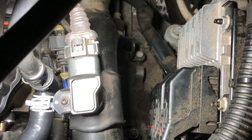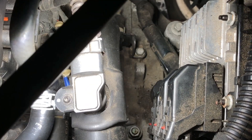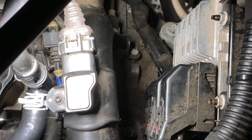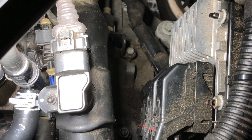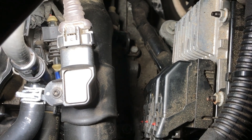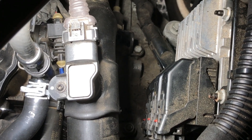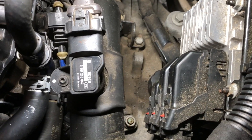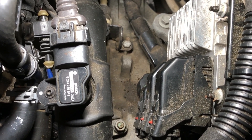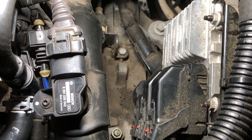That's how you properly do a transmission fluid fill. A piece of advice: it took a little while to heat up — longer than I thought — and you want to leave it idling rather than revving it up because it's not all the way full. Plan on having a good half hour to 45 minutes to heat it up if the engine wasn't hot to begin with. I hope this helps you out, saves you some money, and shows you that it's very straightforward. The only hard part is finding a scan tool to get the transmission fluid temperature. Leave some questions below, hit that like button, and thanks for watching.